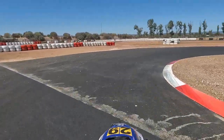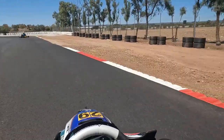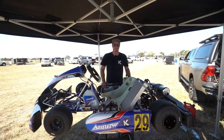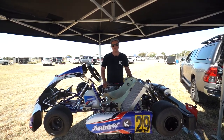We didn't play with the gearing, but I think there'll be some time in that because the new part of the track is very twisty. You might have to put one, two, or three teeth on — lose a bit down the straight but go faster through the new section, or go a little slower through the new bit and be able to pass at the end of the straight. It's going to be pretty tricky with the kart setup. The main trick I found today was just pump your tyres up and drive it slow in and fast out. Let us know what you think in the comments, like and subscribe, follow on Instagram, and look forward to having a kart review video for you soon.